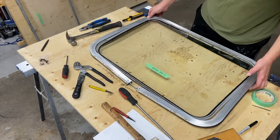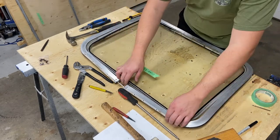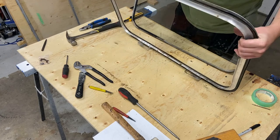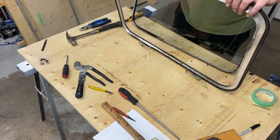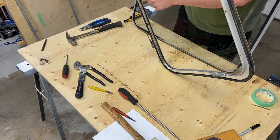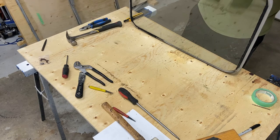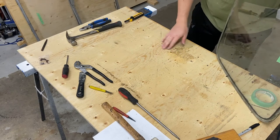When you can't get one of those window sash connecting bars out — especially on these larger windows it's a little more forgiving — what you can do is sneak the glass out without even removing the bottom bar. That still keeps the shape. What we'll do is get that cleaned up. I can see there's a ton of rust inside this channel. Now that I have the bar accessible, I can use a hammer from the side and punch it in one direction.